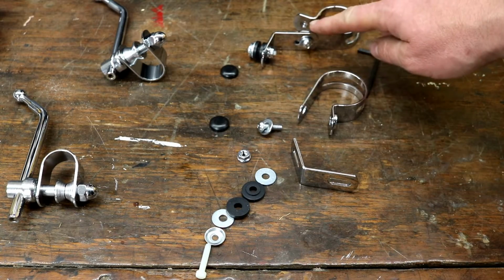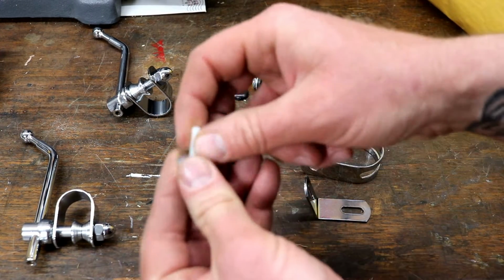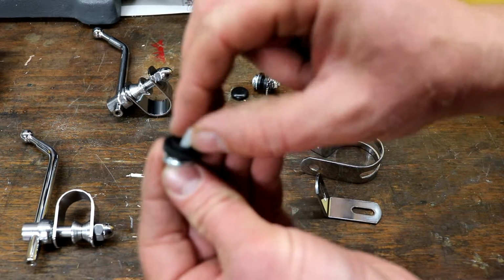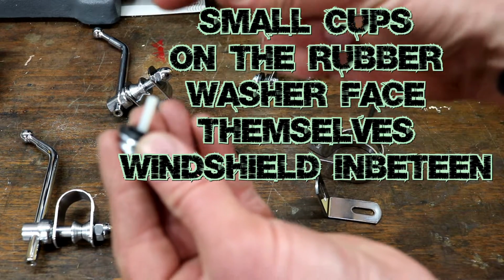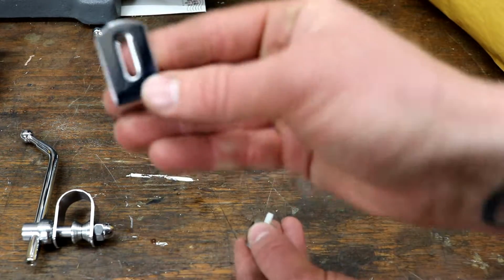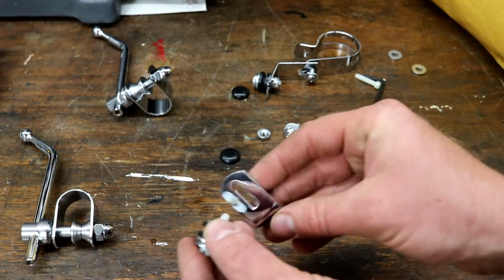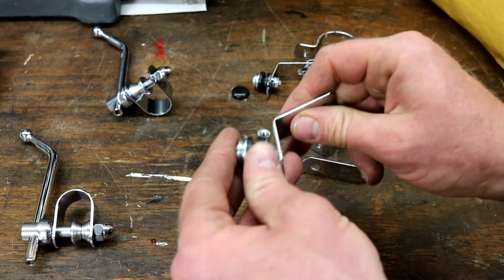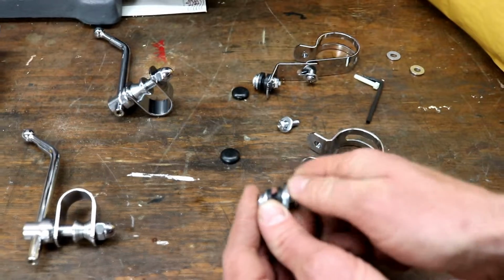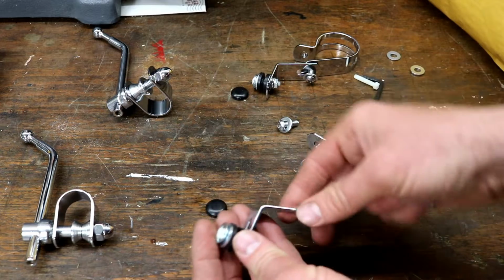And then this one right here will look like this, with a cap on the end, a plastic screw, bowl washer, fender washer. This right here, facing that way so it grips into the windshield. This one here down, so your windshield is sandwiched in between another fender washer. That right there, they don't show you in the instructions, but it's got a large hole and a small, skinnier hole. Goes into the skinnier hole. Gets its nut. When it's all done, it'll get this cap on the outside.